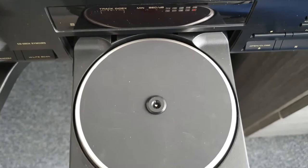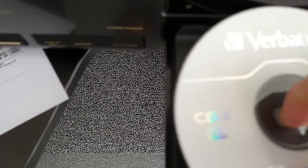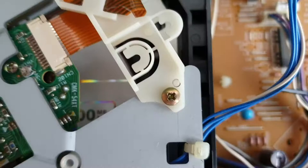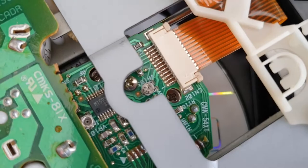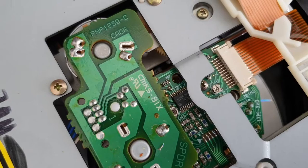Let's check the clamp switch. Let's try again what we already tried — put the disc in backwards and see if it tries to spin up. It does not try to spin up; it's standing dead still. I'll just move the disc a bit to make sure the spindle motor is not locked up. It moves freely. Let's try pressing play to see what happens — just clicking.